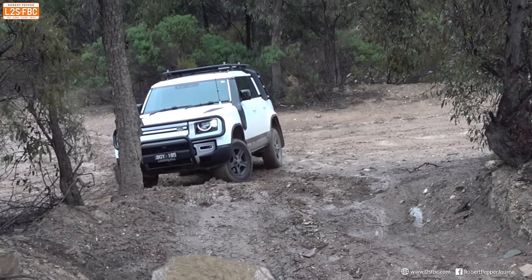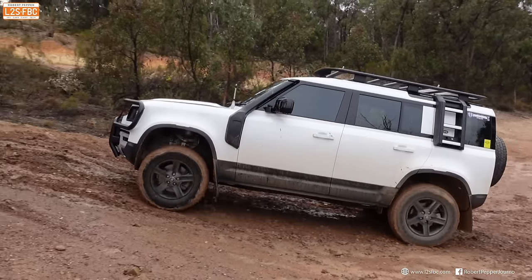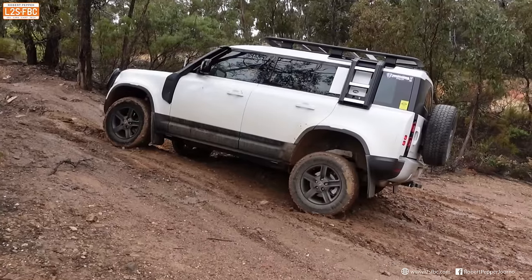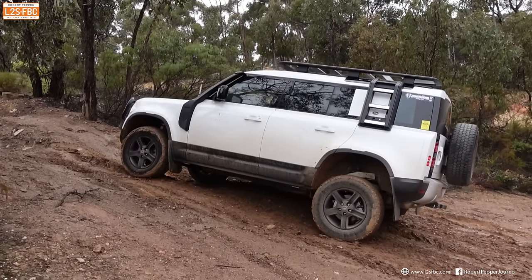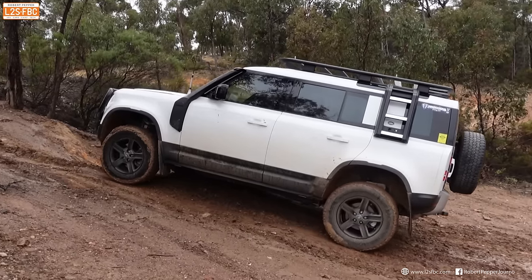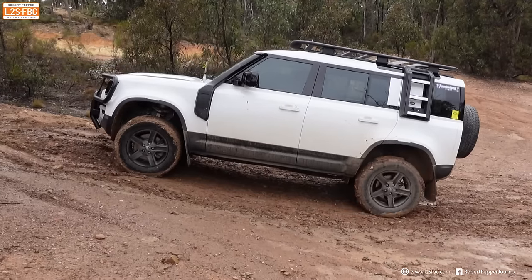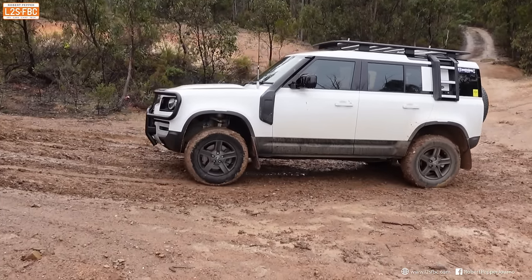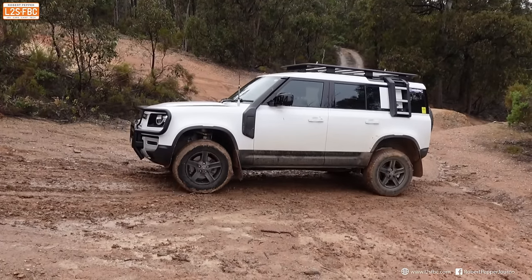The fronts rotate, but the rear not so much. And now we can look at it from the side. That bit's all good, and now it's time to go back — we've failed a hill climb. Look at that: the fronts are just locking in. It's not a cross-axle thing here — both front wheels are locked, and yet we're sliding back, and those back wheels should be providing braking force. And it just doesn't work.